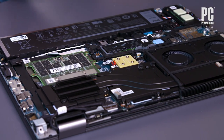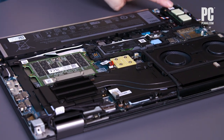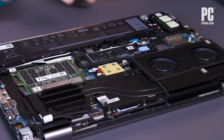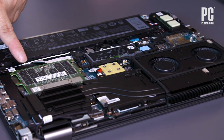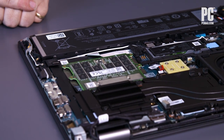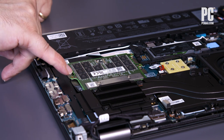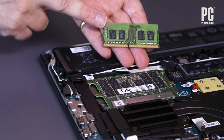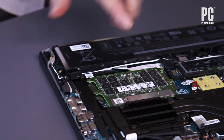There's M.2 storage over here, another M.2 over here — this machine actually has two M.2s in RAID format. But this part may not look familiar. That is the new hero, the new star of the show. I pre-removed four screws around the edges of this module. This is what's known as a CAM memory module. You'll notice it kind of looks like a SODIMM in that you've got a PCB with a bunch of integrated circuits on it, but it's much bigger and it's flatter.